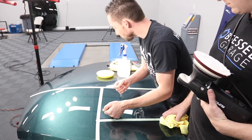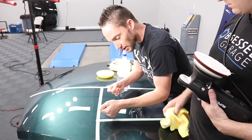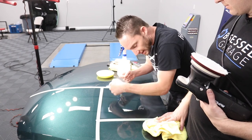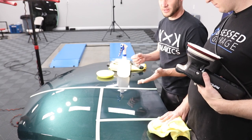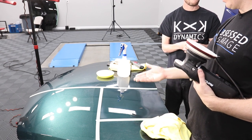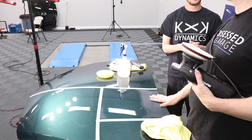But if we're going so slow and we use a compound with a heavy body solvent that creates heat, we lift up the pad, now we see green. So that's why I go at a fast clip. I'm still working a lot of passes, and some would say you're working backwards. So I'd end up working more passes than I did. I did four, two up, two down. So I probably end up doing maybe 12 back and forth. But quicker.